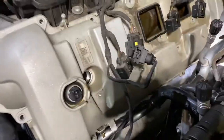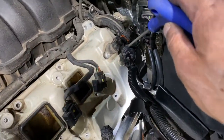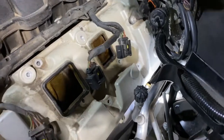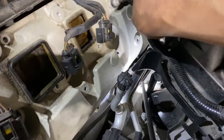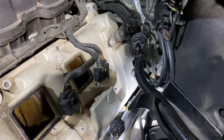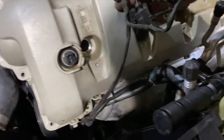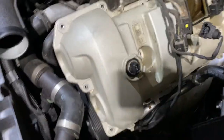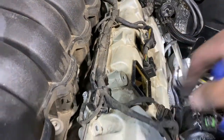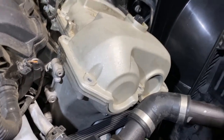Okay, so I have removed most of the bolts. All of them are T30. This piece, I think, is definitely the power cable. I removed those two bolts earlier so that it can slide out of the way to reach above here. I can see it. So there was a bolt here, and I removed those. I checked all of them. Now you can see there is this wiring cable that is kind of in the way. What I need to do now is remove this bolt here, which will give me more room to leverage. The other thing is, I was trying to find a place to crack this open, and I found I can just use a little screwdriver I got.